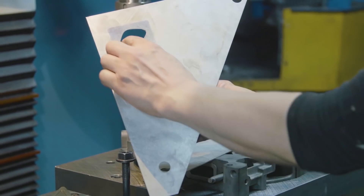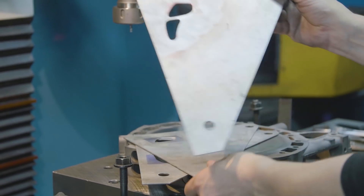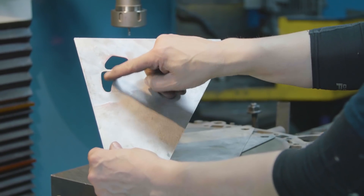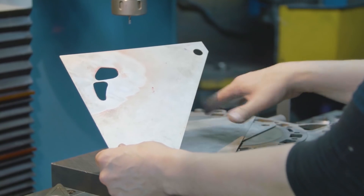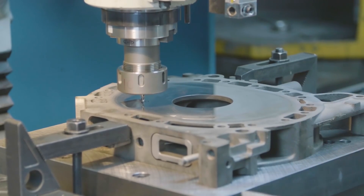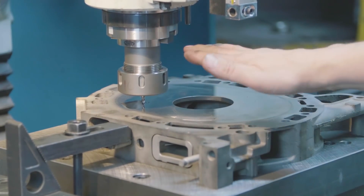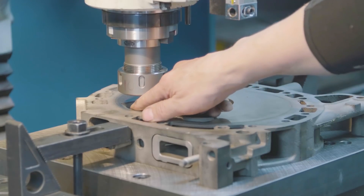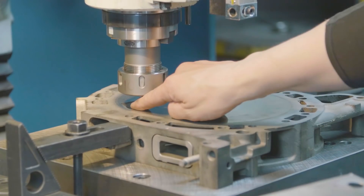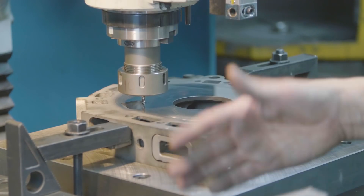This template here is sold just to modify the fifth and sixth ports. In the past when we did the early six port motors we used this template to do the bottom port and the top. Our new CNC program actually has a port program to do the lower port and the upper port, so we will show you that after we cut the center. This particular program we're going to run the primary port first, then the exhaust, and then when we mount the other piece we'll show you the upper and lower intake ports.